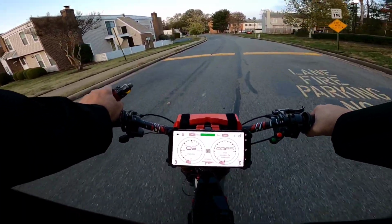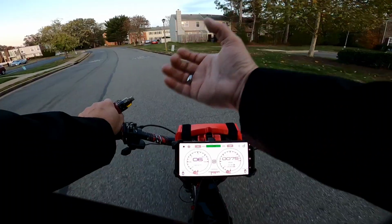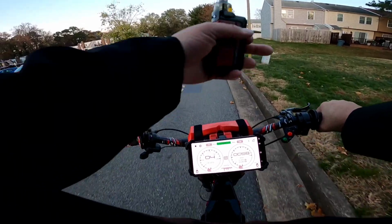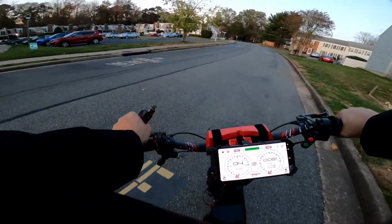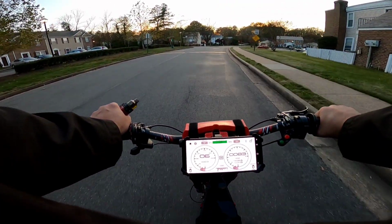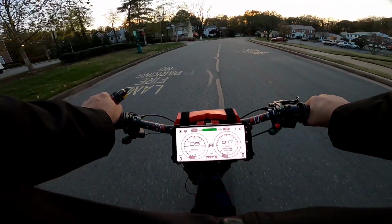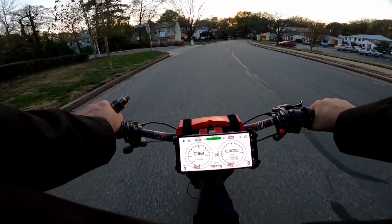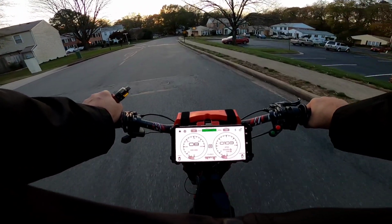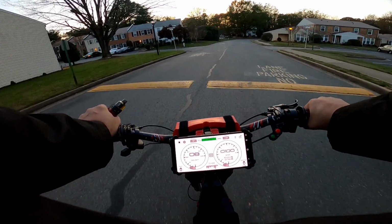Because when they were in series, I had a nice little train set of wire battery system. They were long, and that way I could put batteries in one at a time and maneuver them around. But by putting them in parallel and just connecting the positives and the negatives, that didn't give me very much room to maneuver those batteries around. So it made it like a puzzle to get them to fit inside.